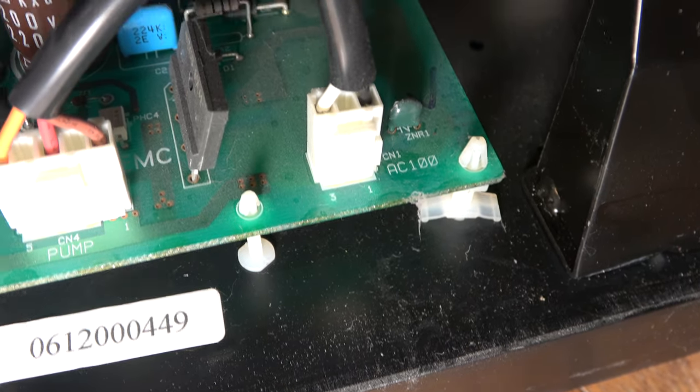So what I'm measuring is between the input ground here and 5 volts, so I've got these sharp probes which are really handy for this. I'm measuring about 0.48 ohms. But if I head over here, I'm getting 0.46 something ohms. She says I'm getting closer. There's a small capacitor here. Well, actually about 0.47. And there's a Zener diode here. 0.46. So it says to me that one of these three components may be at fault, because if I move further over here, further along the board, it goes up to 0.48. So that really does indicate that it could be in this area.